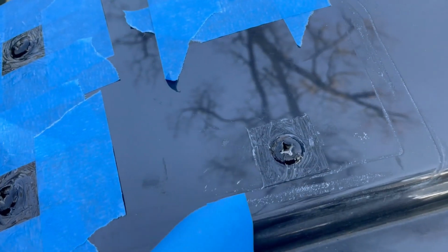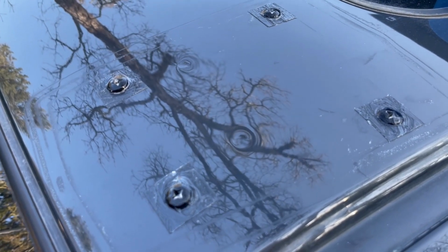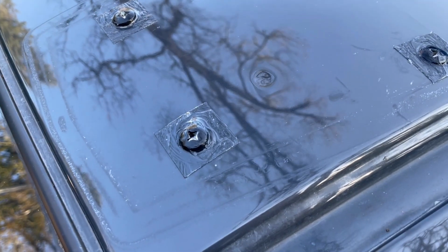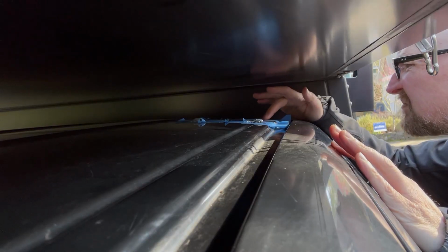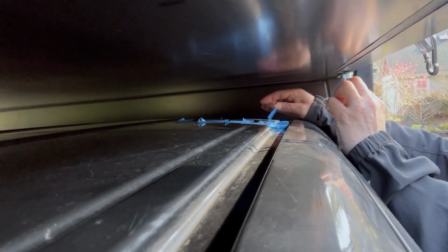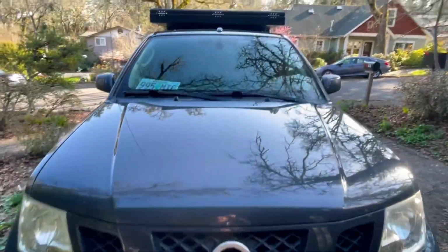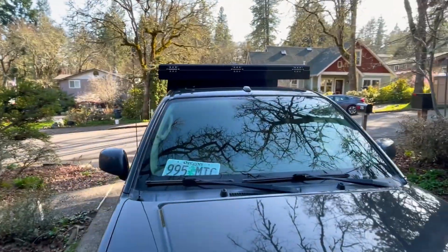While far from beautiful, this was definitely tidier than when I didn't mask it, and it created sort of a little silicone cap over each opening. It wasn't as easy to do under the cab over of the camper, but I was able to cap those with silicone as well. This did successfully stop the water from coming in, and from normal viewing height and distance, it's not really noticeable.